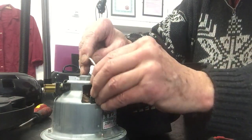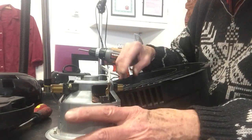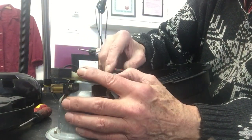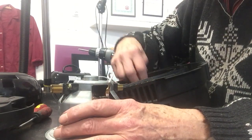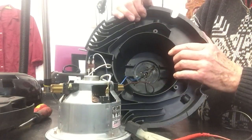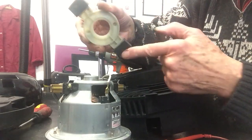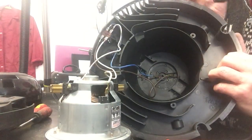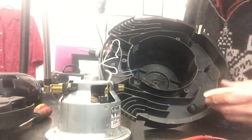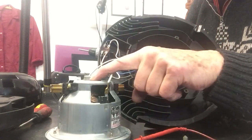There's your one contact there, and the other contact is at the other side here. On the top of the motor you've got this which holds the motor in the right position, and a little cover plate which covers up the leads that go to the ring gear on the other side. The motor goes in here — see those rubber things? They fit in those little slots there. And don't forget the cover for the contacts — that goes on top, these little lugs go in the two holes in the top of the motor and it'll be held in place nicely.